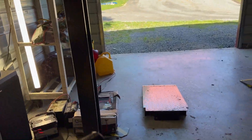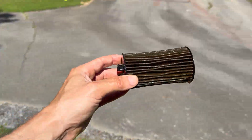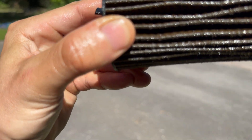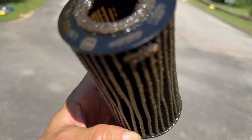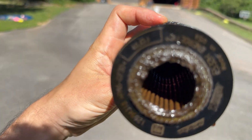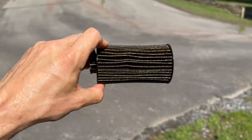Quick look at our used filter in the sun here. It's better to cut them open, but I'm just going to get a quick eyeball. No big obvious metal pieces. I'd expect a little bit of metal during break-in, but I don't see anything too obvious. There's a little flakiness in the sun — could be break-in. It's kind of hard to tell. We'll see what the oil analysis shows and go from there.